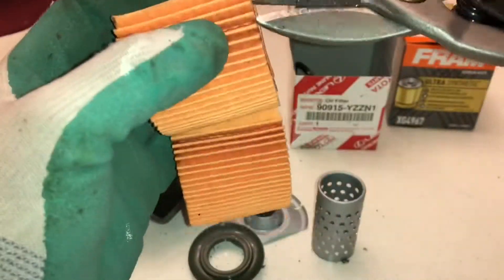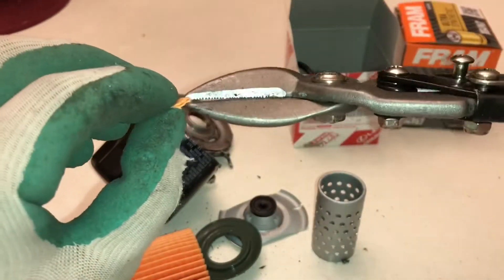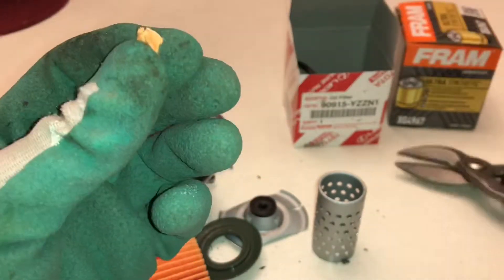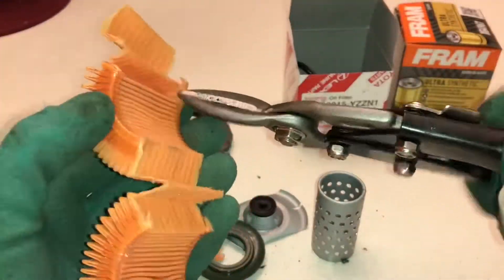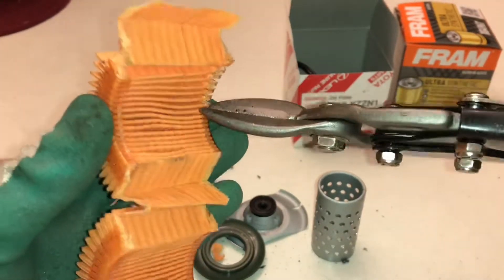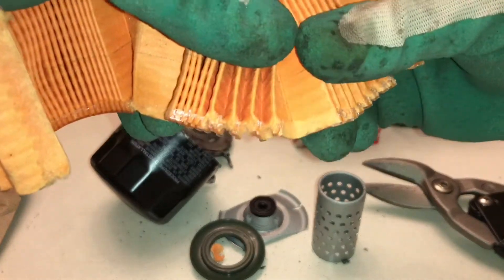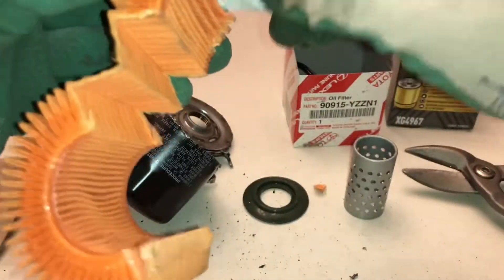I'm not disputing the data, but what I did here is cut it open and tried to rip the paper apart cleanly to show that the Toyota filter actually does glue the outer folds as well as the inner folds. So that's not the reason for the 50% efficiency. I'm really trying to separate them and I'm not able to — they're actually glued together. Having said that, the data does show it's only 50% whereas everybody else is 90% or north of 90%. I think maybe Toyota is trying to balance the strain on the oil pump versus how clean the oil is — that's just my guess.